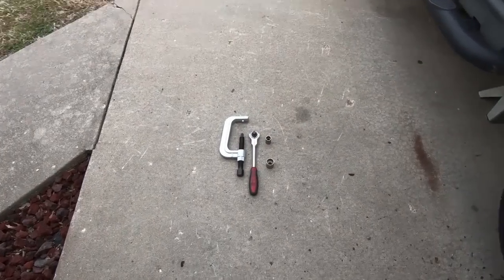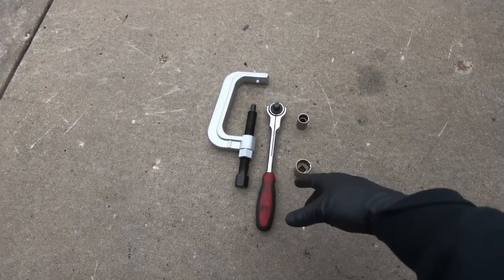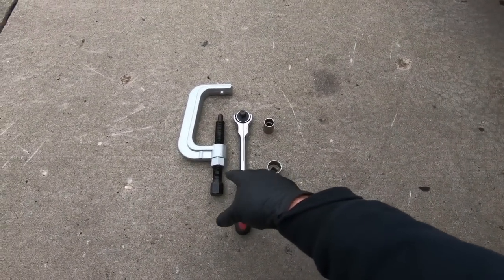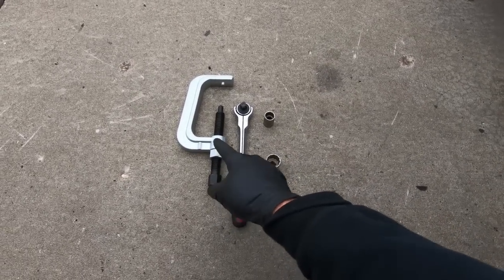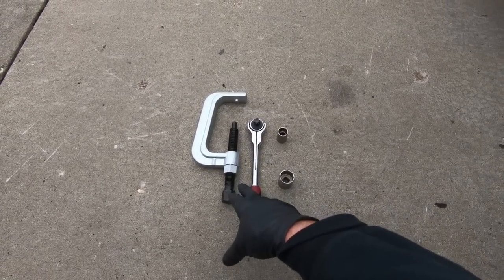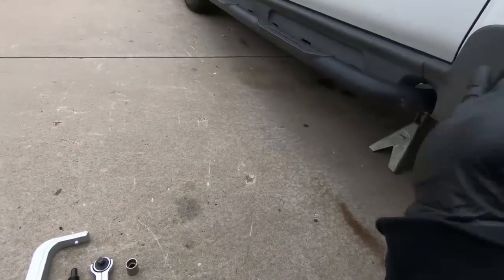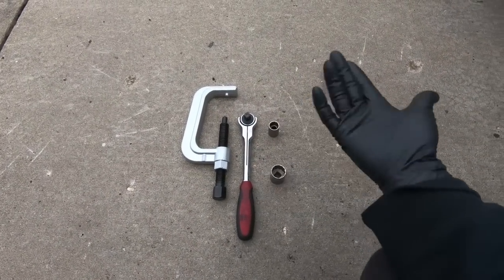So to replace the torsion keys, obviously we've got it back off the ground, but you really don't need a ton of stuff. You need a torsion bar key release tool. You can also use a 3-jaw puller. A lot of people do this. I actually rented this from a local parts store. They generally have it on hand. I will also link it in the description if you guys want to buy one. But for what I'm using this for, I'm probably not going to do a ton of these, so it's worth renting it every time I use it.